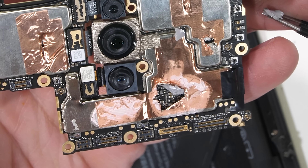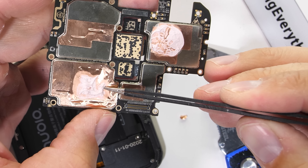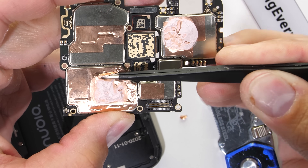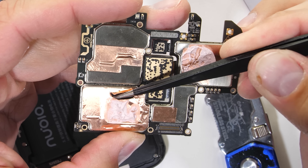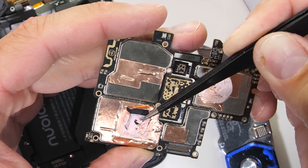It's quite a unique order of heat-dissipating materials, but if it works, it works. The processor is on the other side of that complex cooling sandwich, and it also has its own copper sticker that touches a heat pipe resting below the phone frame. So there's cooling all over the place, even if it is all over the place.